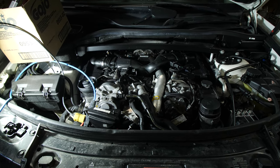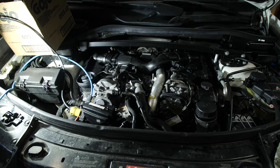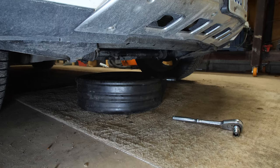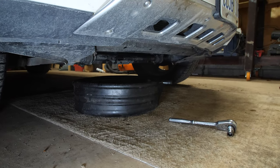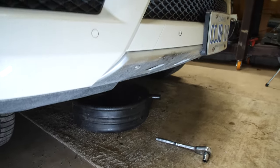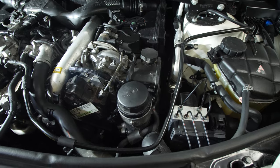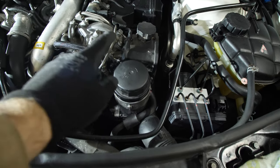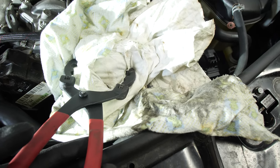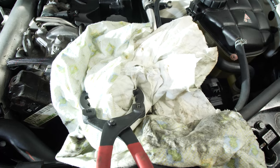All right, to start off we're going to drain the oil. I'd suggest draining the oil to make less of a mess when you remove the oil filter housing. There's an underbelly shroud you have to remove some clips and pull out — it's a 13-millimeter bolt. I got the vehicle super hot driving on the highway, then popped the drain bolt and let it drain. Up at the oil filter housing, you can use a huge socket — I'll put a link in the description — but I just threw a rag over it and gently opened it with regular oil filter pliers.